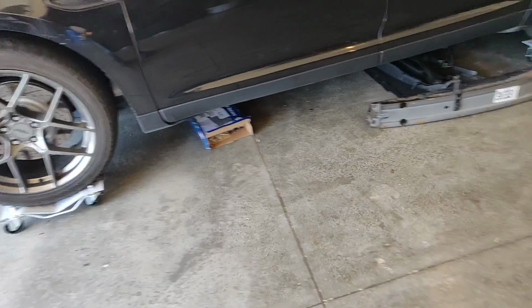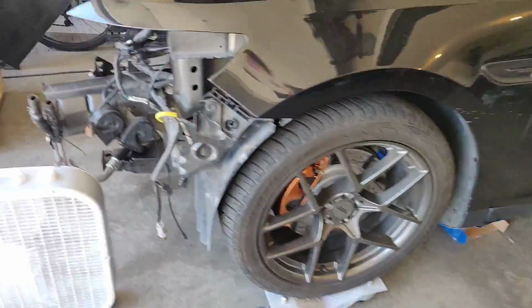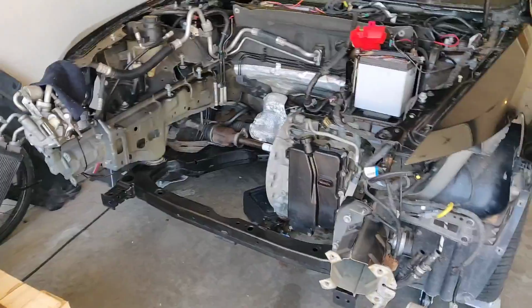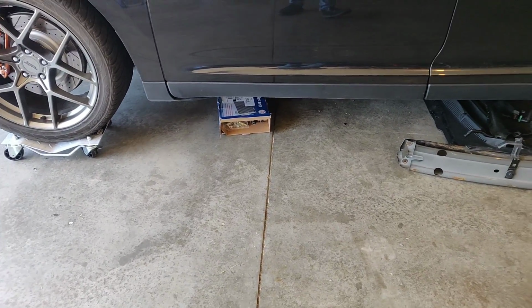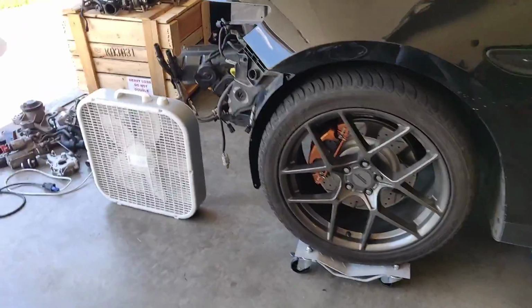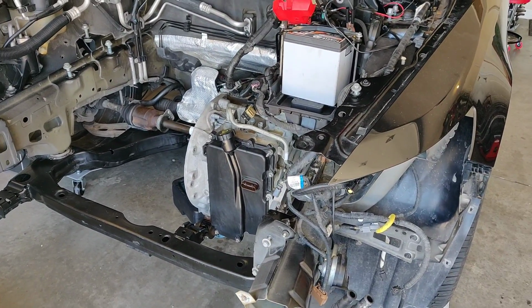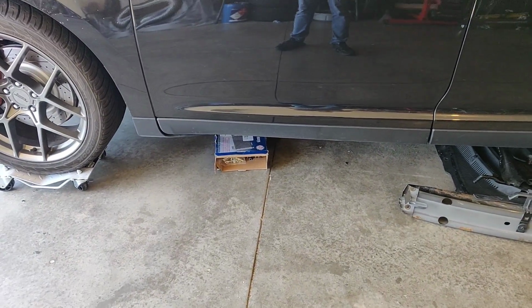Like I said, I bought that on eBay. It was like 140 bucks. That is the True Cool 40K. I couldn't find a vendor who was selling one that I know of. But a buddy of mine who has an LSA supercharged regular cab short bed, mouthful, with a 4L60 is pushing some obscene power through it, and that trans cooler is keeping his transmission alive. And the 4L60, let's just say, it's a little bit more fragile than our transmission, I'd say. But ours go out for no reason also. So based on his experience, I decided to go that route, and that'll be a nice add-on for sure.